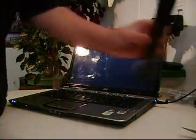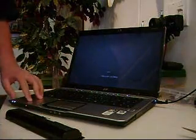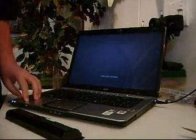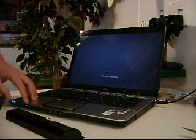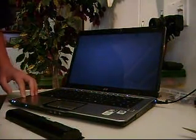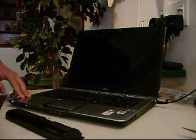Then you can just pop the battery back in. If this doesn't work, you can try it a couple more times, but if it still doesn't work, it means that the motherboard is defective and it's best to send it back to HP. They have extended two-year warranties for the laptops with the bad motherboard.